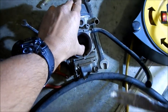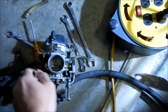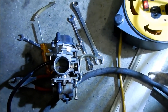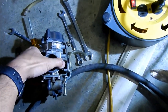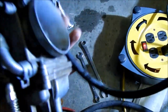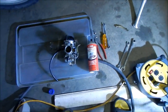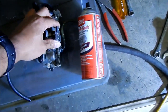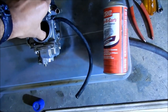The slide does not move — that's not good. The little throttle plate does not move either. I don't know why, but we'll shoot some carb cleaner in there and hopefully that will solve the problem. We'll have to clean the carb. I've gone ahead and sprayed the whole carb with carb cleaner — in the throat, in the slide, and everything. I don't think it's still moving, so we're definitely going to have to tear into this carb.